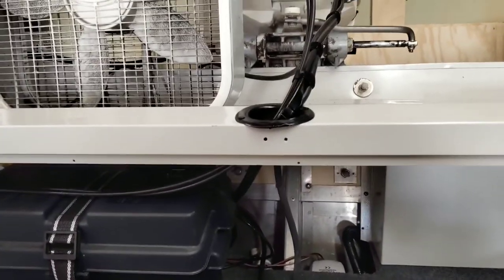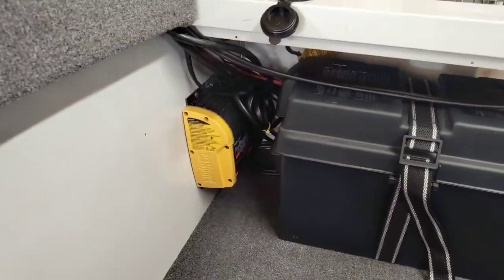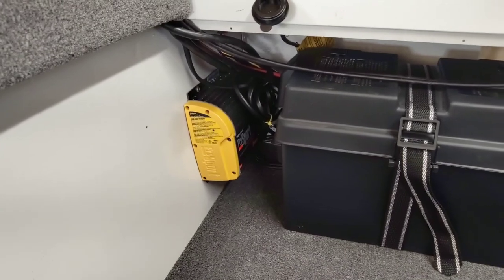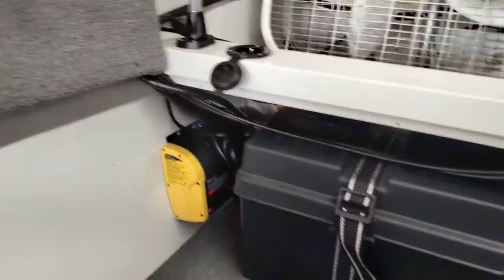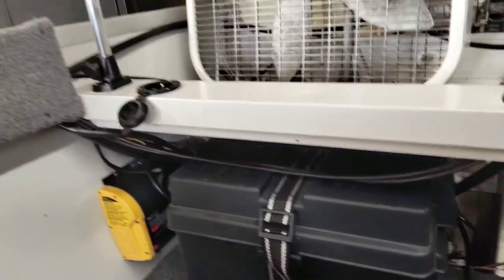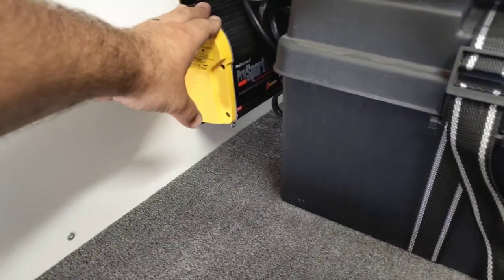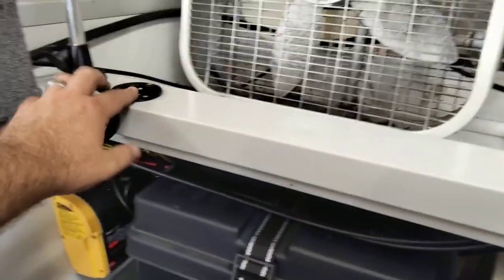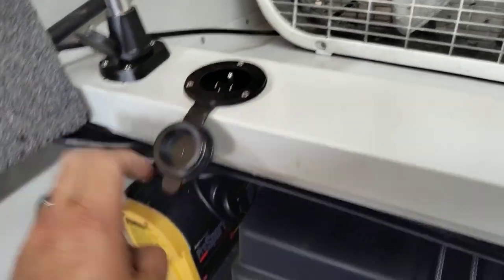I don't have a seat to sit on while I do it though. Let's discuss the wiring — people seem to get confused on boat wiring, but it's really not that complicated. On this boat, and every boat I've done recently, I use an onboard charger. This is a Pro Mariner Pro Sport — it's a dual bank, so it charges both batteries. I have a permanently mounted plug here, a shoreline outlet, so I just plug an extension cord into it and it instantly charges up. I don't have to go chasing around trying to find that cord.